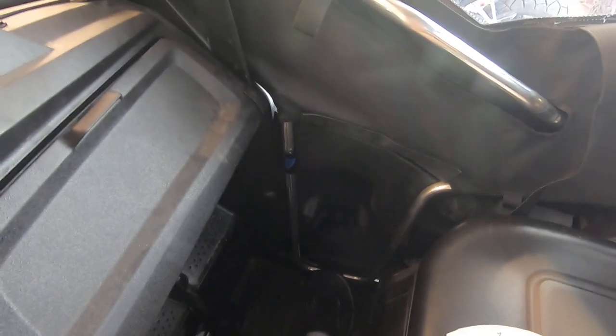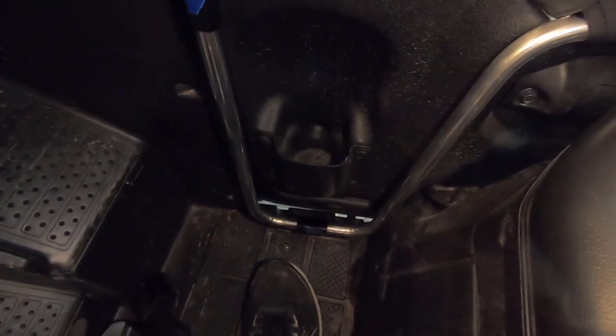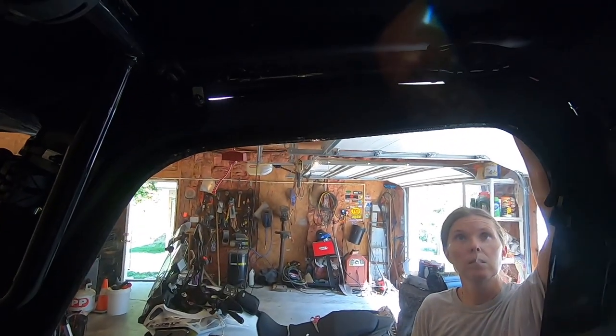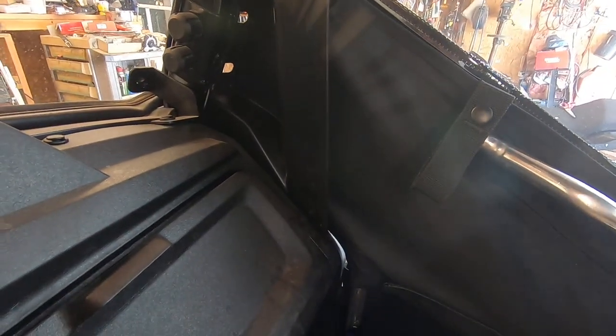All right, so now we're on the inside. Get the light on here, see if this makes sense. So you can see here on the inside, how it looks, and it's sticking out pretty far from the bottom. So I'm just gonna take my foot, push it against the bottom down there before I trace it. And up here it'll be easier to trace. You can see right where it's gonna be there. So I'm just gonna trace those on, and by putting my foot here, it puts a lot of compression on the door. It holds it tight. The only thing I don't like, you can see some gaps, especially at the back here, but you want to have the doors positioned as best as possible, so this is the minimum amount of gaps and it fits in the pocket where it needs to be.